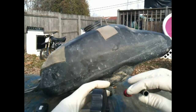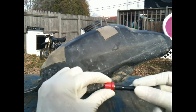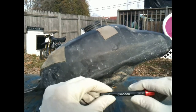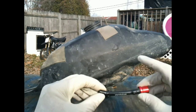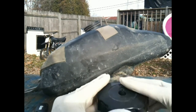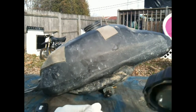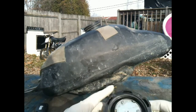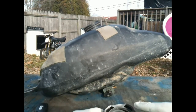Or you could have dirt in your vent line. Very easy to check a vent line — if you don't have one of these little caps on it, you can look down the hose. If you do have a cap, just give a short little suck through the hose and it should draw air right through. Another quick check is to just shake it — that's actually a ball bearing moving around, which pretty much means it's not stuck, but there could still be a clog.